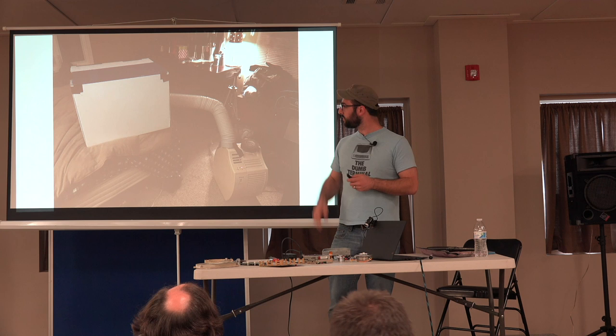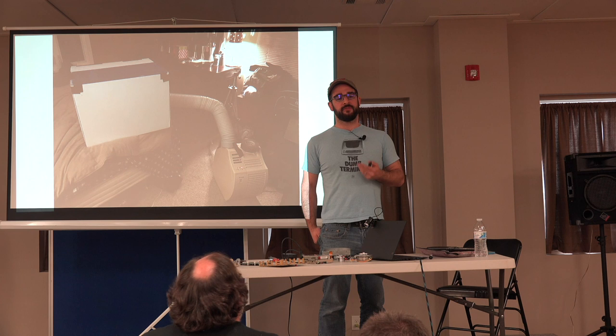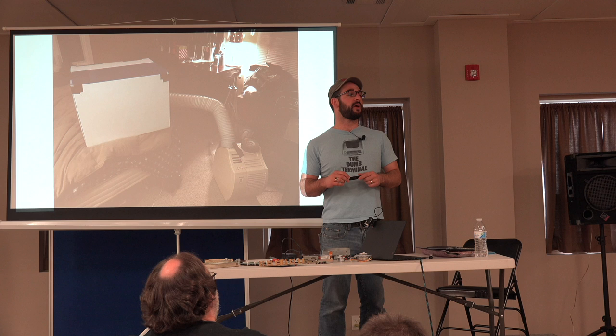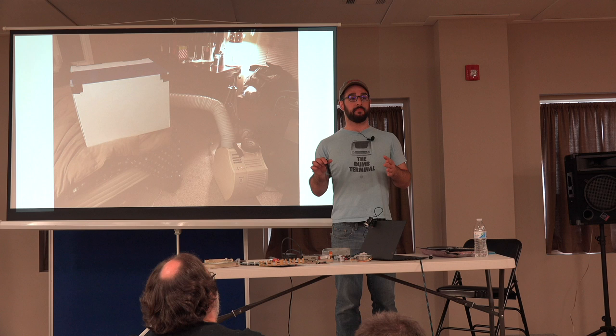On that same drive, the one with the glass scale, was that considered to be a more expensive drive because of the dimensional glass scale? This is a pretty early voice coil hard drive. Apple got a big case of not invented here syndrome in the late 70s, early 80s. This disc was actually manufactured by Apple. It's one of two hard drives their disc division made, and I think the only one that actually shipped. Someone will probably correct me, but I think this is the first time a more personal type computer had a 5 1/4 drive with a voice coil actuator.